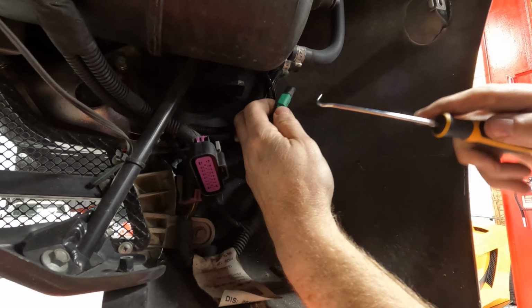Don't forget to go back and tighten up these band clamps, so we'll do that right now. These you want to be fairly tight, but be careful not to break these things, they're so expensive. All right, let's remove the old exhaust tips, 10 millimeter. You'll notice one of them came out with the nut cert, so I'm gonna make sure that goes to the right spot. Out with the old and in with the new.